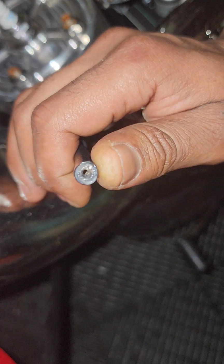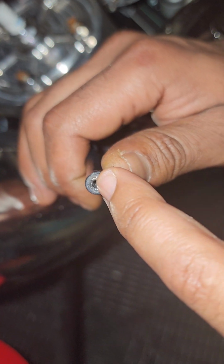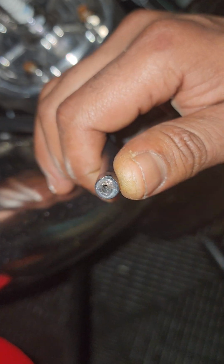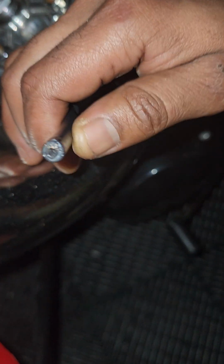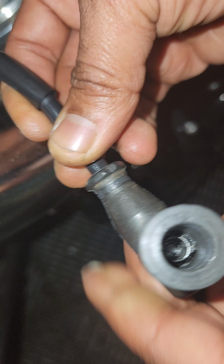Those of you who don't know, these spark plug boots are replaceable, they come off. When you take that boot off, inside there, if I could get this to focus, see that copper wire that's in there? You want to see as much of that as possible. So I already did it. I cut it back. These were brand new coils from Yamaha, and there was no wire exposed at the end of this, and this was screwed in.